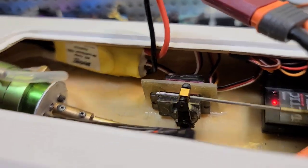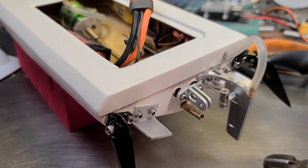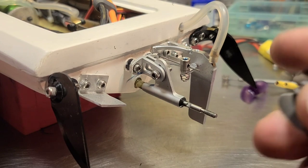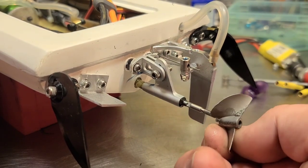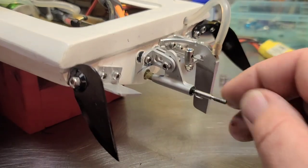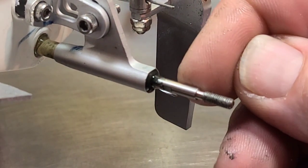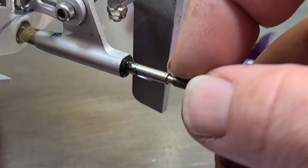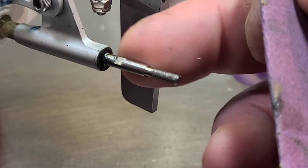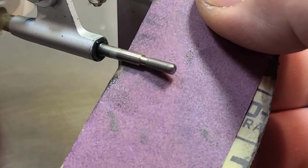I've got my wires a little consolidated — I'm going to grease up the cable and spool it up and see what it sounds like. I ran into a little problem: I had my drive dog on and went to put the Aquacraft mini mono prop on, and it won't fit on my shaft. It's an eighth prop and it just won't go on. The shaft's got the eighth part and then a machined-down area where they cut threads in. I don't want to take material off where my drive dog sits, but I don't want to fight my propellers every time.